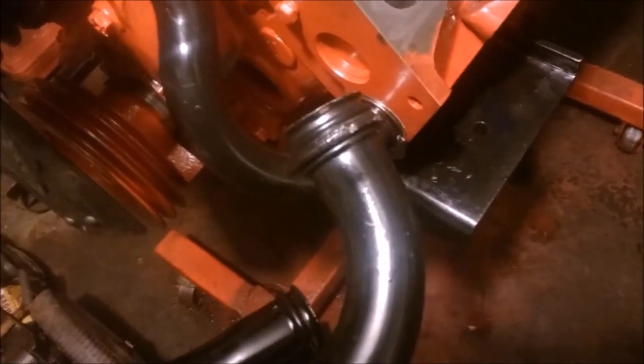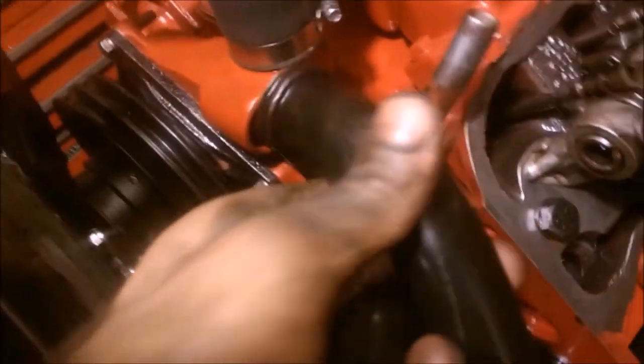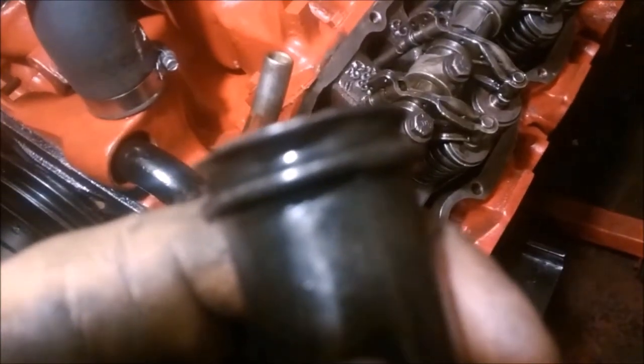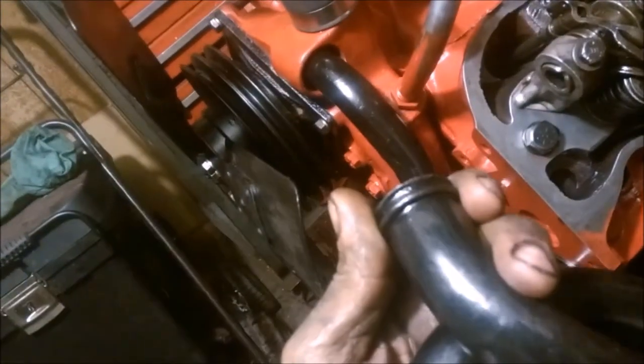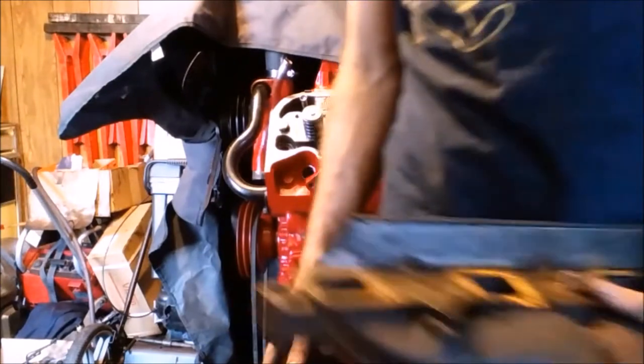When I put the new O-ring on and installed it, I just slid the one end in and slid it on. If your ends are chewed up, put a little anti-seize — I used copper — or a little Vaseline, whatever you've got, just to lube the rubber seal so it doesn't get torn. Sand it out real good, bare and smooth — that's your key to a good seal. The rubber O-ring could get caught by silicone as it sticks and tear it as it expands. You don't want silicone in there.